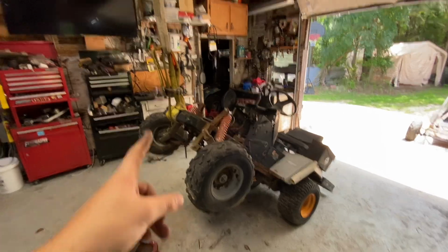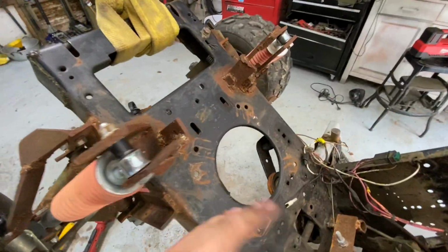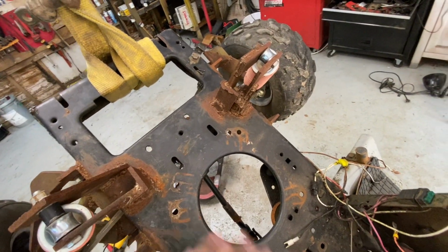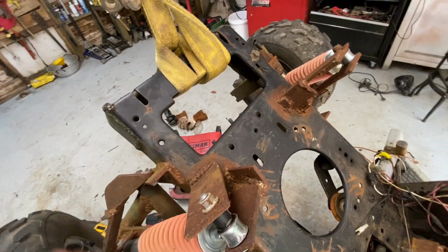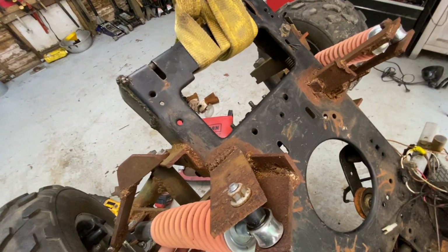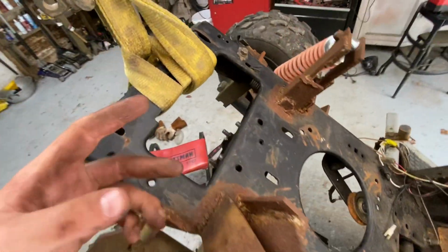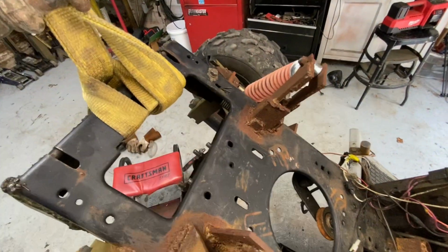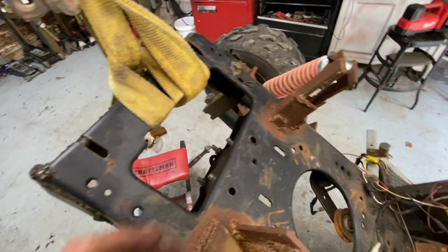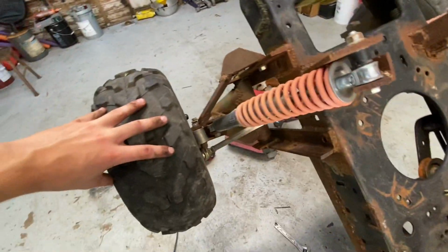All right, so I got the Craftsman attached to the ceiling, and I've been working on getting the steering shaft ready to be welded in solid. Before I just went in and got it all welded in super solid, I wanted to mount my steering rack in tight so it doesn't move at all and get everything all dialed in. Before, I just had the two carriage bolts that went around it, but they pulled it in a weird way and tried to bend it a little bit. And that bound up the steering shaft and kept me from moving the tires.